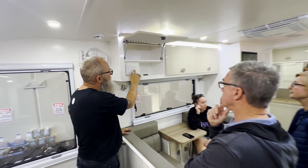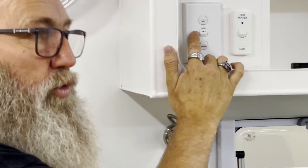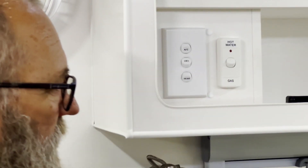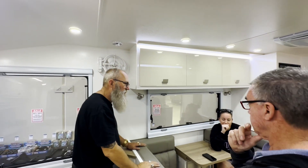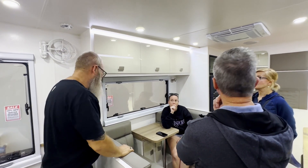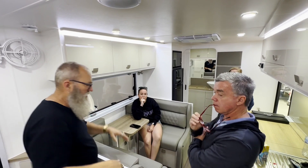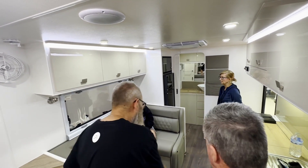You can choose which you want to use. When putting the van in storage, make sure you turn off your hot water service — turn off the 240 switch, otherwise it'll keep heating.